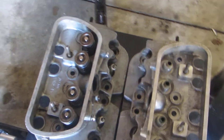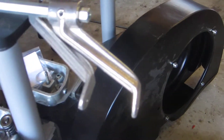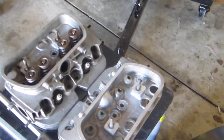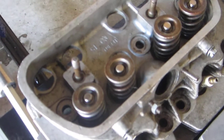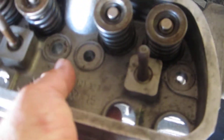Let's talk for a moment about these heads you see on the stand, and a couple more down below. These are two sets of 1300 heads. One of them is NOS — new old stock — it doesn't have any springs, retainers, keepers, or valves, but it does have the guides. I'm not sure of their usability yet; I'll have to get some valves and give them a wiggle test. The other set is a factory VW head — both again are 1300 heads. This one has a little bit of time on it but seems to be in good shape after a preliminary checkout.